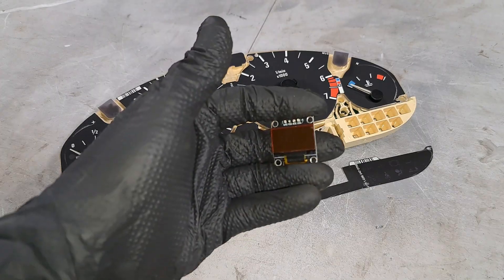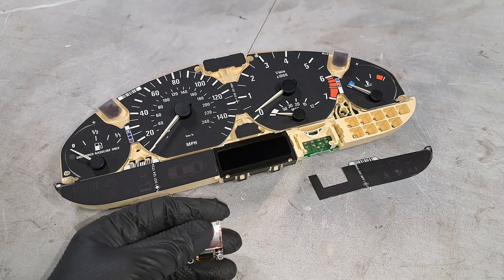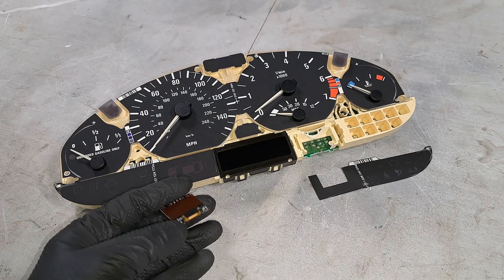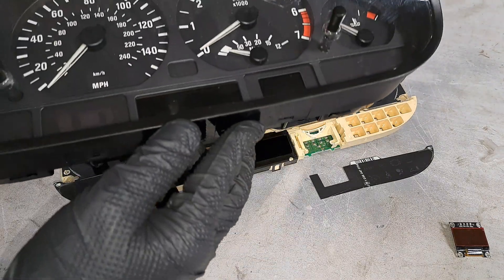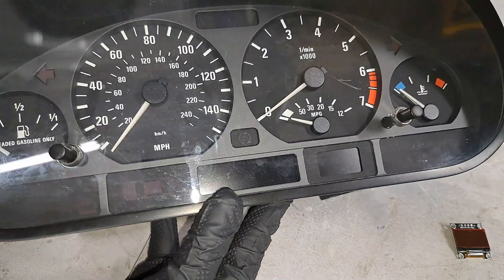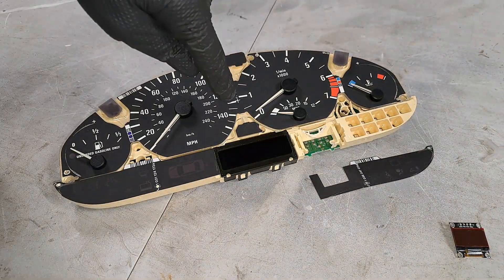When it comes to installing this LED display, if your car is not an automatic transmission, you're going to need to source a cluster from an automatic car. I'm just showing you how I'm doing it — you don't have to copy it exactly. We are going to disassemble this automatic transmission gauge cluster and use parts from inside it for the manual transmission gauge cluster.